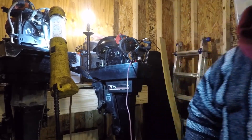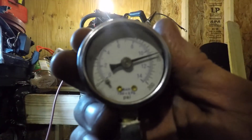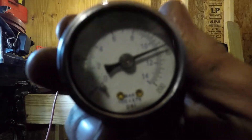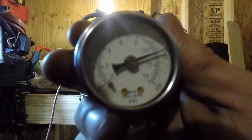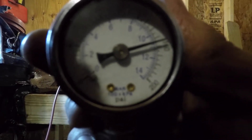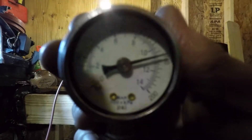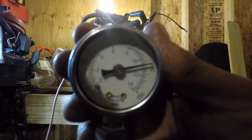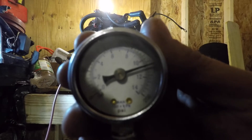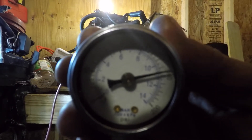That's all I need. Now I'll disconnect my battery again - I got it. It's probably hard to see, but we're looking at about 158 psi. So our top cylinder was 160 and our bottom one was at 158. So this is a runner - we got spark and we got good compression. We'll see you soon.